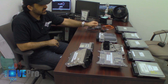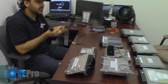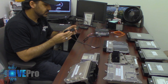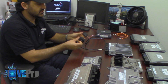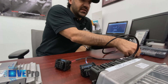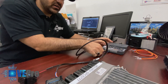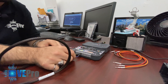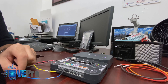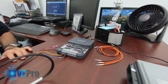One of the unique features about Flex is they came up with the MDG1 cable. What's nice about this cable is it saves you time and headache. Instead of finding which pinouts go into the ECU, you're able to just plug this into the appropriate plugs and get it out. The individual lines that need to be plugged into the Flex box also have labels — for example, this blue one says B6, so right away you know that goes to B6, and the rest of the wires apply as well.